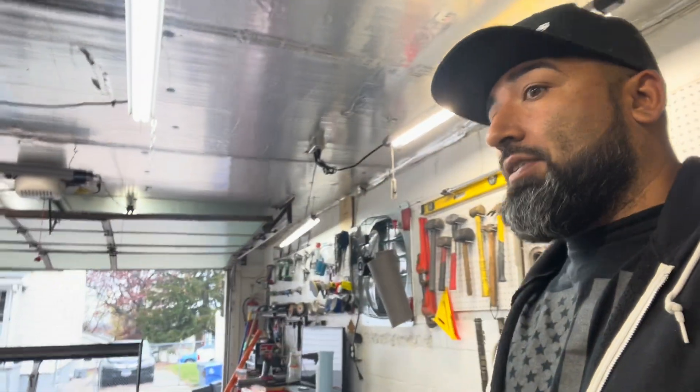If you need the links just comment below. So here's the carbon hatch — it's not done being layered with epoxy yet, but I kind of just want to cut the shape out. I'm going to be using an oscillating tool with a wood/plastic/metal bit. I'm just going to come around the edges and cut all the way around. Have to be careful right here where this rubber is. Once we get that all the way around we'll finish epoxy on the other side. When you do this, please make sure you wear long sleeves, gloves, and some kind of breathing protection — you don't want to be breathing in the little shards of carbon fiber dust. Look at how well this tool cuts — pretty good. I usually go back with a sander and just clean up these little edges.